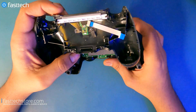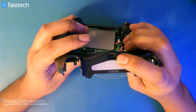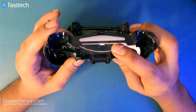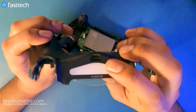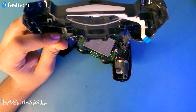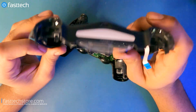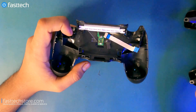There's a cable running in the middle — we're going to remove it by pulling it out. Now we have the back separated from the front. I'm going to talk about the back real quick. The back houses the USB charging port and the light bar. The charging port breaks quite frequently on these, especially the older controller models for the PS4. This is one of the newer versions, but either way it's very easy to remove the port.